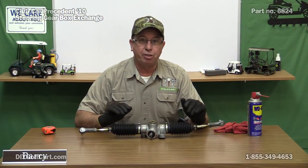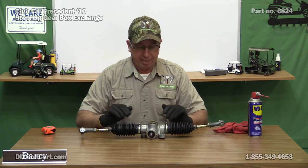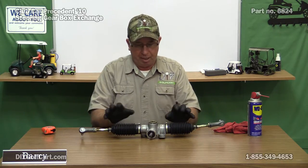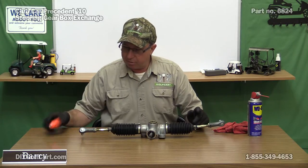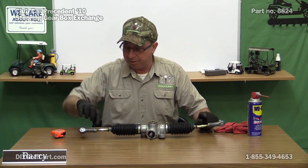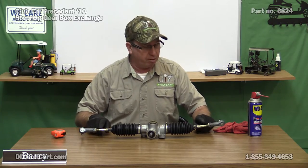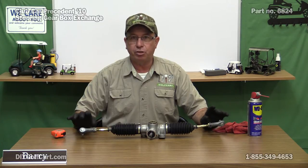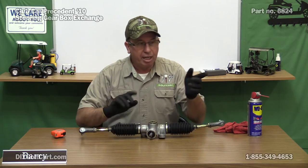It's amazing what a little warm soapy water and a little shot of WD-40 will do to make it look like a brand new one. Now if you are replacing your steering with a brand new steering section, a couple things you want to do. Make sure your bellows are the same length — that way you'll get it pretty close to straight just like you had it. Second, with a measuring tape or some type of measuring instrument, measure the distance between the jam nut and the beginning of your threads on both sides when you replace your ball joints. This will help you get a lot closer to your toe-in being right, which will really help in the end. I got this cleaned up, let's go put it on the car.